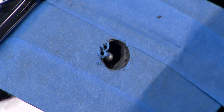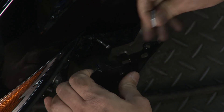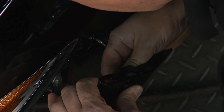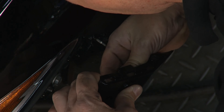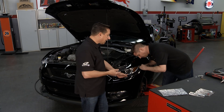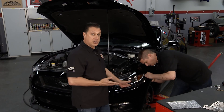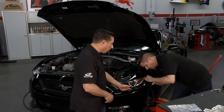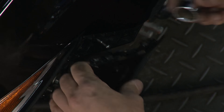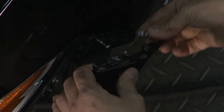We've got the masking tape off, and now it's time for the payoff. We're going to put the body in there. We've done some adjusting on the pin, and we're pretty much on the home stretch. I'm going to get that threaded nut on the back there. The depth of the pin is a trial and error process, frankly, depending on the fitting you want. You're going to have to put it in and take it out, just to make sure it actuates the body of the quick latch perfectly. Every car is different, so it's going to be a little bit of work. Brian is putting the nut on — going to put it in place, and then we're ready to rock and roll.